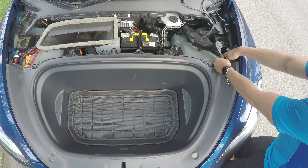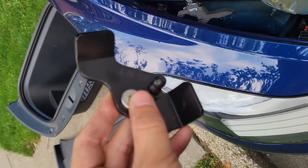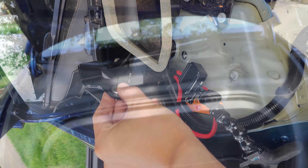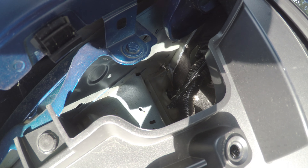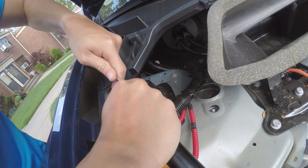The main points of this install are swapping out the two struts — one here, one here — into power struts. There are brackets which come with it to change the position of one of the ends of the struts. I think they do this because the power strut is pretty generic, and so instead of creating an entirely new strut, they just created a bracket that offsets the mounting locations so you can use this power strut with this particular car.